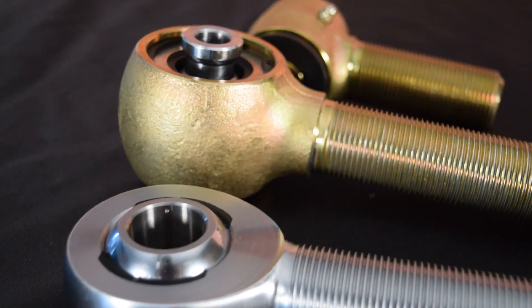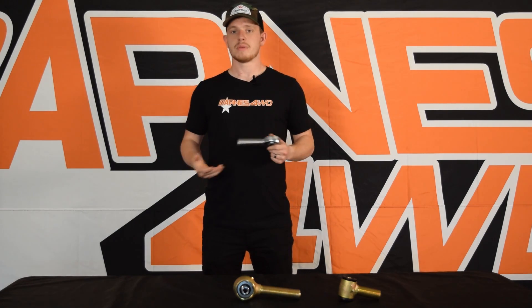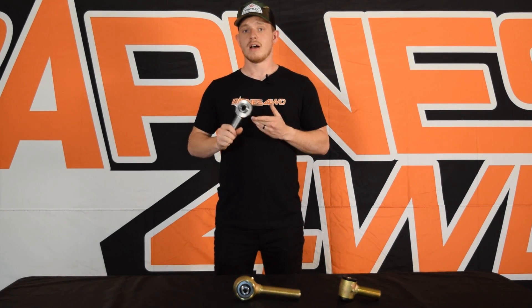Maintenance is also more involved. This is an open joint — versus the Enduro joint where everything is closed up in the body — so all dust, dirt, sand, and snow you go through is going to get into this joint and there's just no stopping it. Some people make heim joint boots but those just make it worse. You have to keep them clean — if you go on a trail run, come back home and clean them. We recommend a dry lubricant; WD-40 dry lube works pretty well. Don't use any wet lubricant because that will cause contaminants to stick to it even more.